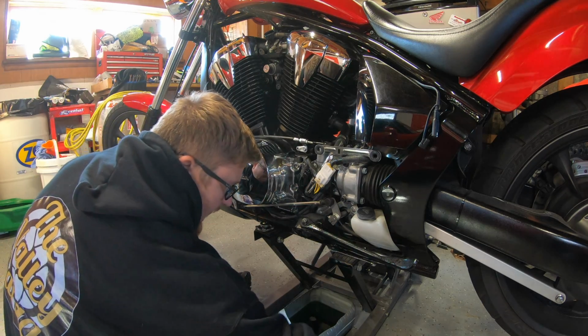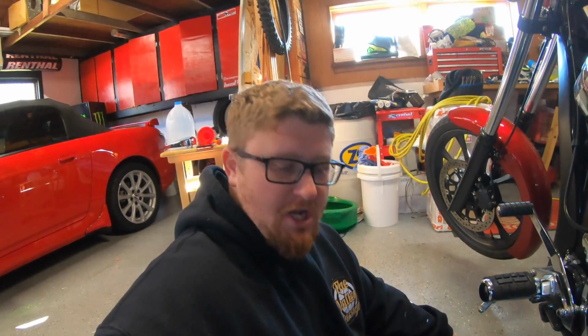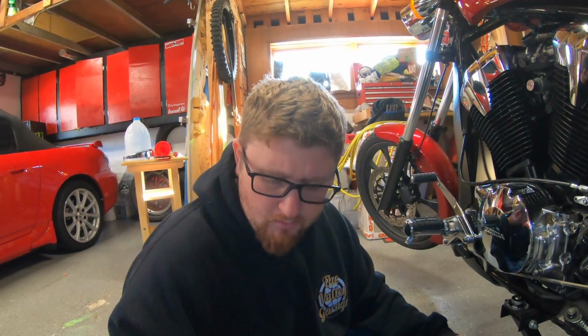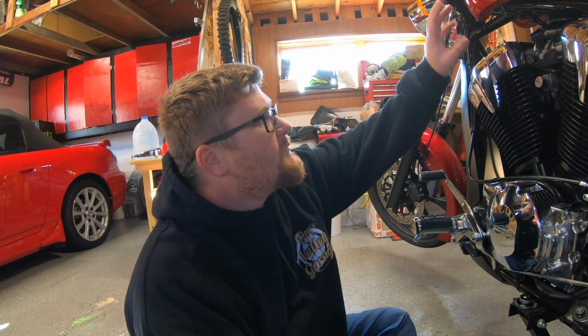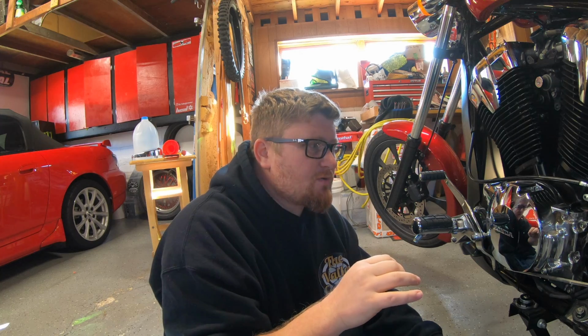All right, now. Clean coolant is gonna be like green Gatorade or Predator green blood. If it bleeds, we can kill it. That's a bit darker, so you can tell it's about time to change. Okay, so once you've got your drain bolt out, popped the cap, and drained all the coolant out, I'm gonna thread this back in, and we're gonna pour some distilled water through, and run the bike a little bit to clear out any residual in the system.